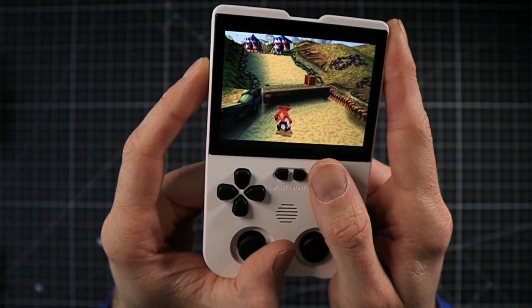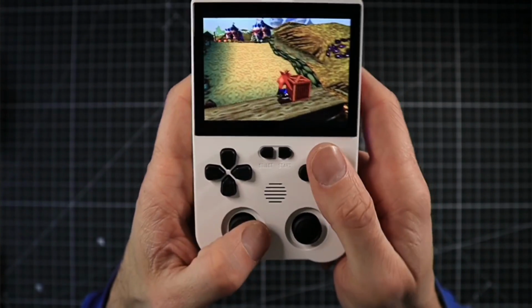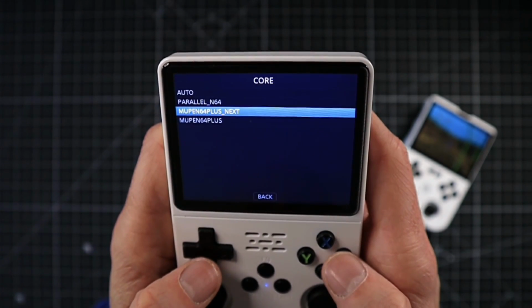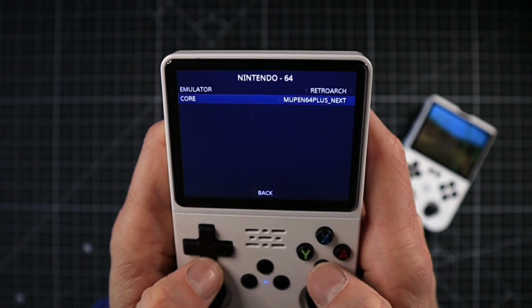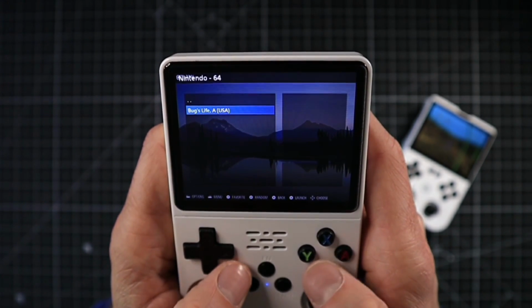They seem to be very consistent across the board, although I will note I have had a couple of issues charging my R36S if you don't use a low enough powered charger. In fact, you can run into some serious issues because it doesn't have a controller chip for incoming power, so make sure you don't use anything that's too powerful. You can actually brick your device.